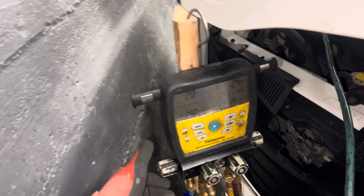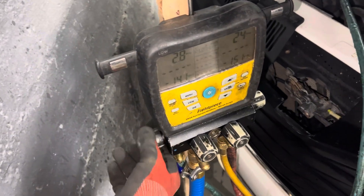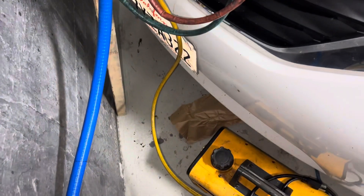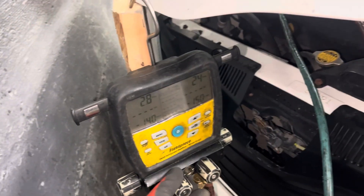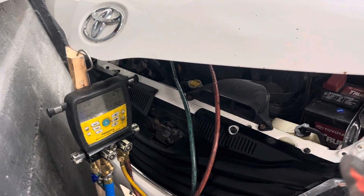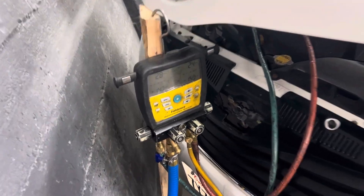That's good enough — no chance of unplugging something and getting oil splashed in your eyes or mouth, because that oil tastes terrible. Denso oil for Toyotas tastes really nasty — bitter and sour — and even after brushing your teeth, eating Lifesavers, and drinking a Coke, the taste still stays in your mouth. So that's it — it's now ready for disassembly and there's no chance of atmosphere being introduced to the system after recovery. I had it under 900 microns. See you guys later.